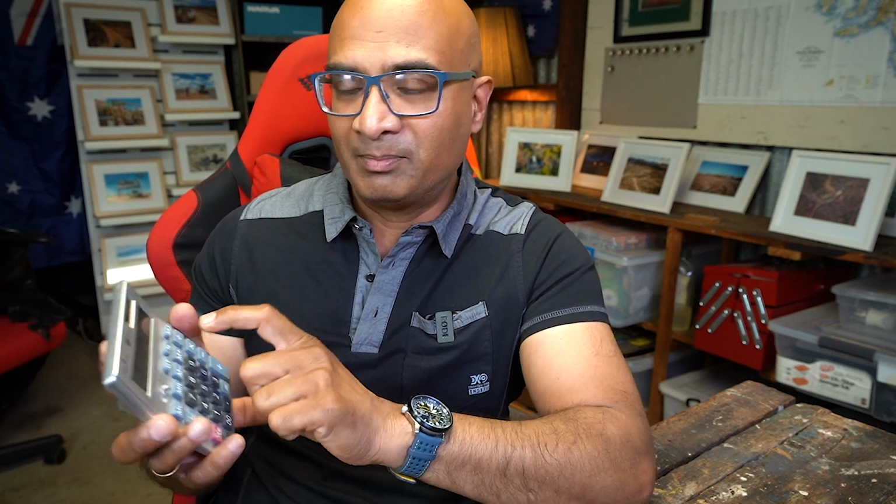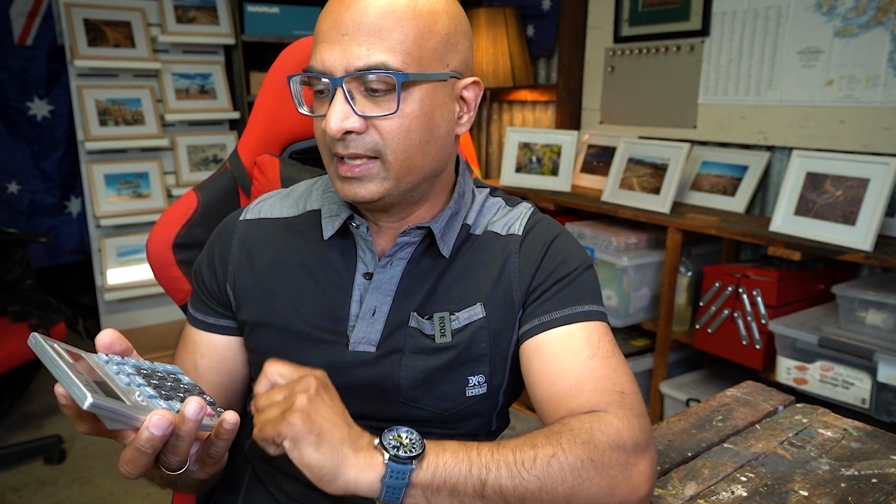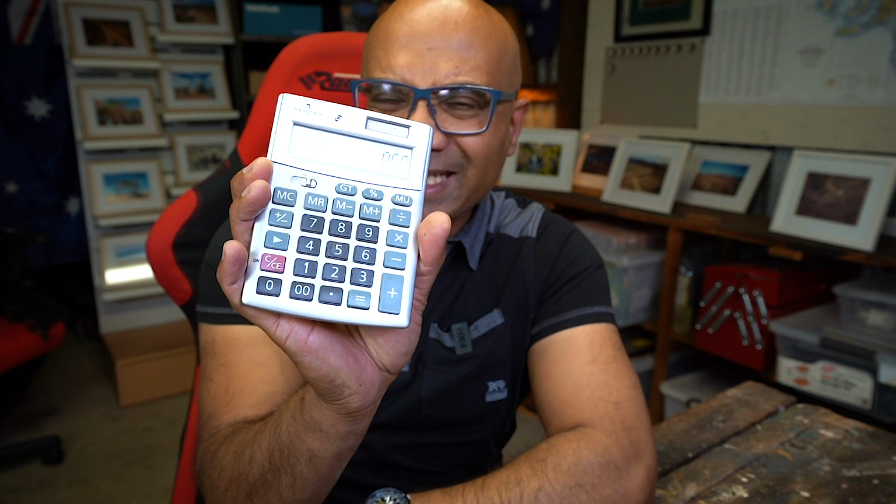So 60 amp hours is all I've got, divided by the 7 amps that it's going to be consuming right through. That means approximately I get about 8, perhaps 8.5 hours of supply. Now that's a rough calculation. Some of you who are experts, or you may be an auto sparky who's watching this, might argue with that, and that's perfectly all right, because like I said, I am no expert, but that's my rough calculation. So I get approximately 8 to 8.5 hours of supply at that consumption, which is 7 amps.